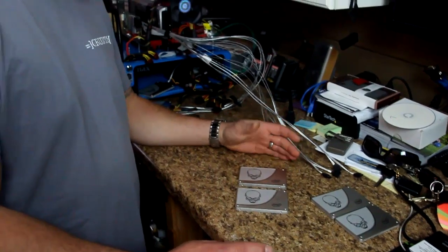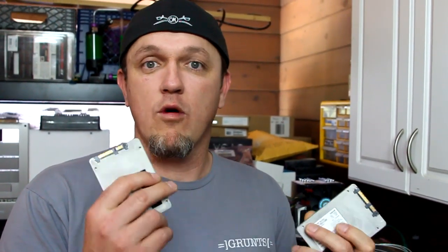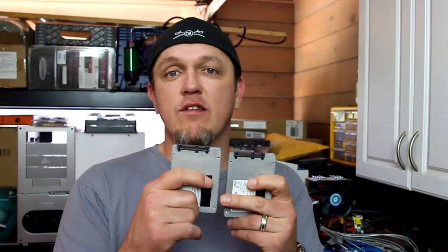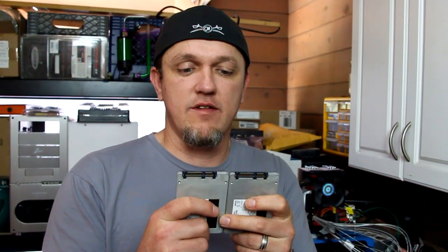Let's talk about the different RAID levels. The most commonly used are RAID 0, RAID 1, RAID 5, and RAID 10. RAID 0 is basically taking two drives and making them one — you get more performance. A single drive reads and writes at 550 and 470 MB/s, but if you combine two drives in a RAID 0 you get about twice that, maybe even more depending on how you set and tweak it.